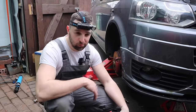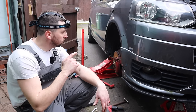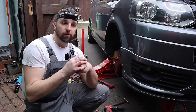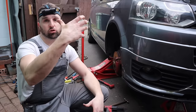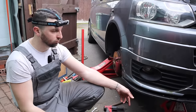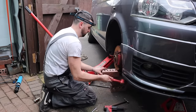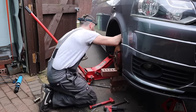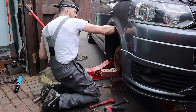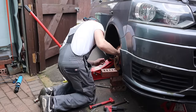This is just real, guys - I'm just showing you how it goes, working it out as I go. I should have made sure I undid the top first and then carried on down here. When I undid the male part of the strut that goes into the hub, I could then knock the hub down and the strut stays where it is. At the minute I've got no weight to pull it away to separate them - I need a second jack, but I'm being lazy.